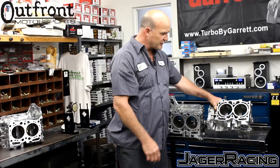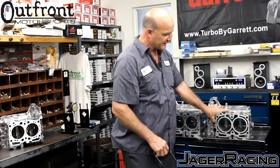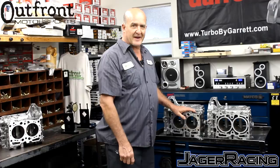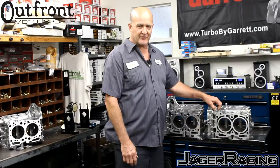The objective is to fill this area without restricting water flow through the head gasket and into the head by putting an insert in. We've been doing closed-deck blocks since the year 2000 — about 15 years. As demand has grown, back in 2000, STI and semi-closed-deck blocks did not even exist. They did have a two-liter closed-deck from Japan, and we were trying to mimic that closed-deck block on the EJ-257 block.